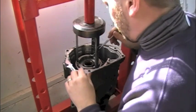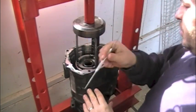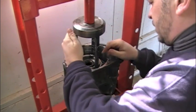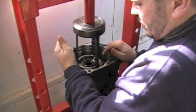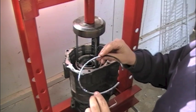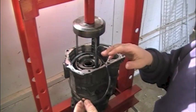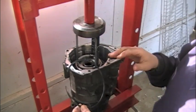Now we're going to move on to the snap ring on the overdrive direct clutch drum. You can use a flat screwdriver — I like these little picks. You're just going to find an edge where the steel plate drops into the drum. Start at the end of the snap ring and pop an end of it out so it releases. This is what we call the wavy snap ring. We do offer the updated one on our website. These are common to break — they'll actually shatter into four, five, six pieces. A lot of the time you'll find pieces in the bottom of your pan or on top of your valve body. Even though they're in the back of the tranny, they have a tendency to work their way forward.